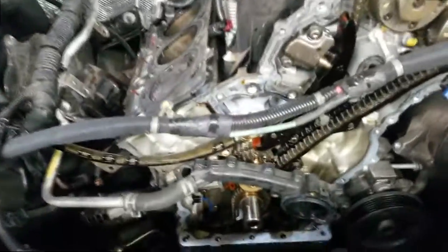I'm not sure you want to do this job yourself. What I'm talking about is the Grand Cherokee 3.6 — any 3.6 for that matter — because the timing chain has got to come off to do bank one. Meaning wherever cylinders one, three, and five are, that's the side where the timing chain has to come off to do the job. Let me take the camera down and show you all some of what I've got going on.